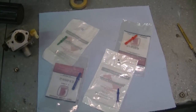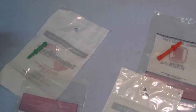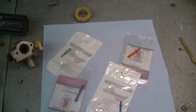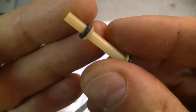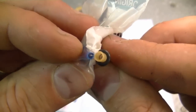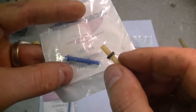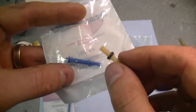Here I have a variety of different emulsion tubes for Tecumseh carburetors. As you can see they come in all different sizes, shapes, and colors, so it's easy to identify the tube you need to replace. I don't have a clear one like this one here, but you can see it's different from this blue one — the inside diameter is much bigger on this one. It's very important that you use the correct emulsion tube when replacing it.